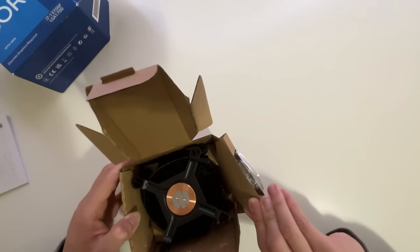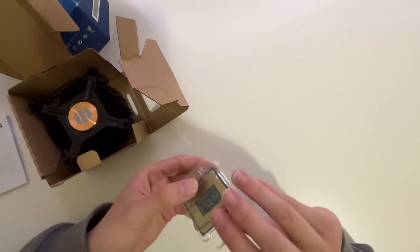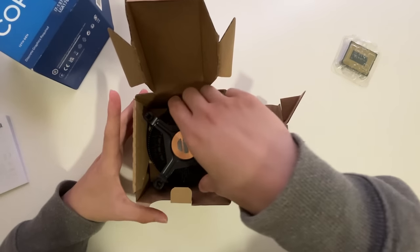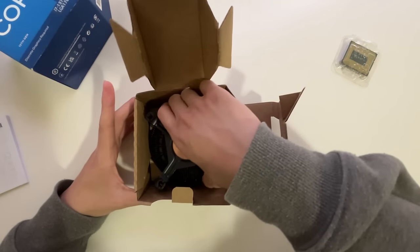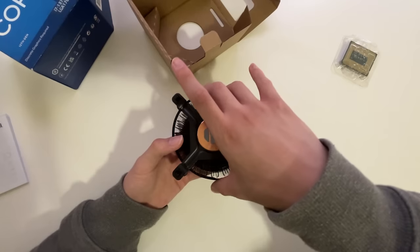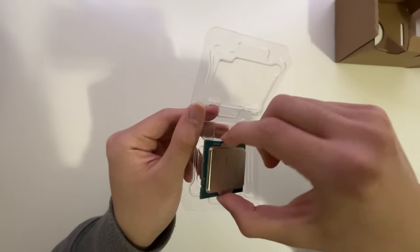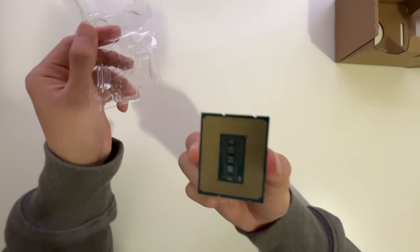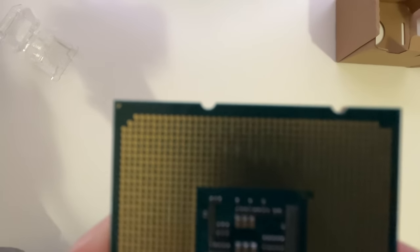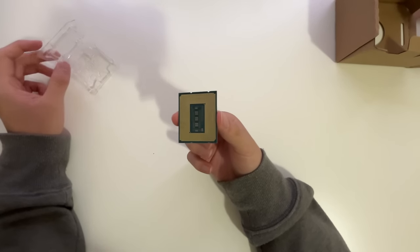I have to be very careful. The CPU is fine, hopefully — here it is, the CPU. I got to be very careful with this. The fan has thermal paste over there, so I just have to make sure not to touch that. The main component here is the CPU. Got to be very careful not to touch any of the pins, so I'm holding it from the sides. At the top left there is a little arrow-looking thing — we're going to use that to put it on the motherboard.